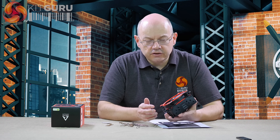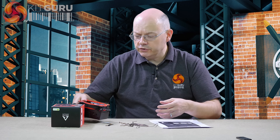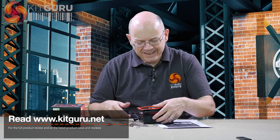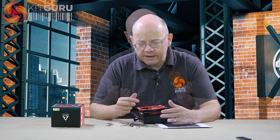The result of our testing is that the Arctic Freezer 33TR can indeed handle a 12-core Threadripper working very hard. Once you overclock the processor, it's out to lunch — temperatures are far too high — but that's fair enough. Arctic was never claiming it could handle a 250-watt TDP; it was saying 180 watts with a bit to spare, and it did exactly that. Impressive stuff.